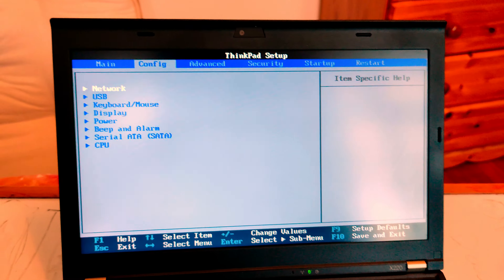I will open the readme. It mentions: whitelist removal, unlock AES-NI on non-encryption machines, be careful with the advanced menu as changing some options may render the laptop unbootable, and more memory speed means more heat. To flash BIOS, run winuptp.exe from one of the modified BIOS folders. If you are already on 1.46, then use flash.bat.